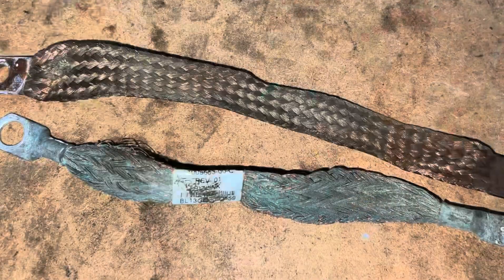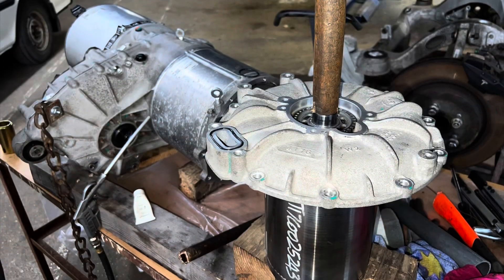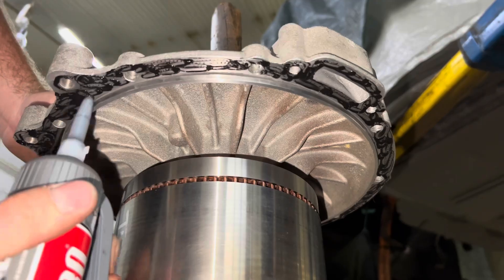Installed a new half shaft seal, changed the old harness cable. Apply sealant — silicone sealant — everywhere. Install the rotor unit back to the housing and use a torque wrench for tightening bolts.